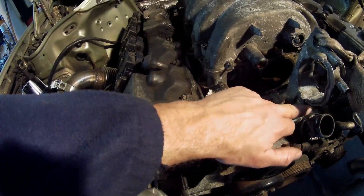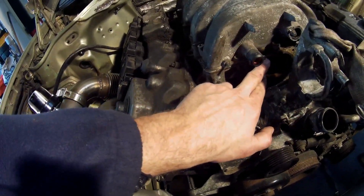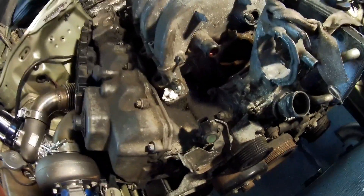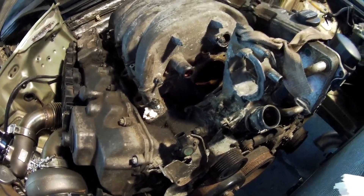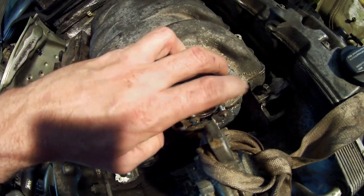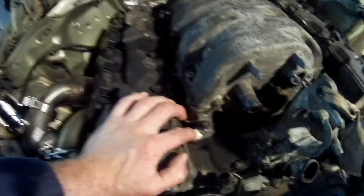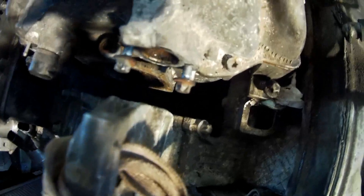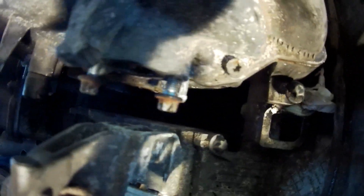There is a problem here — this needs to be cut off completely as low as possible. There needs to be an adapter plate on here, and then a small bend upwards so the throttle body can be repositioned. This is the EGR stuff that needs to be blanked off. I also have to figure out something here because there is a hole in the block. Also on this side, to cover it up. I think this hole goes nowhere, but I have to look into that — otherwise it also needs to be blanked off.